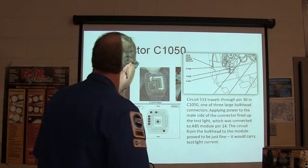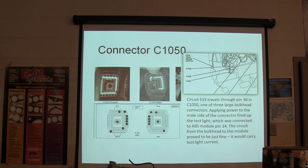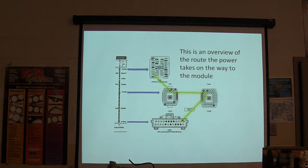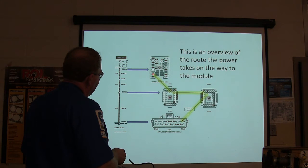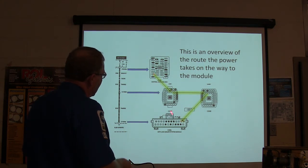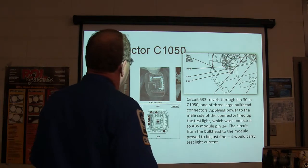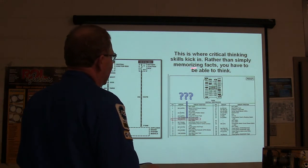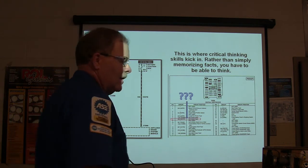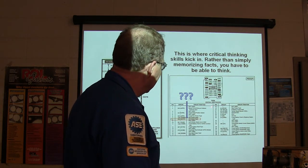The junction box sometimes has to be replaced. It's laminated with plates inside - you can't take it apart and fix it. Sometimes a windshield leak wets them and causes all kinds of electrical gremlins: headlights that won't turn off, speedometers going to 25 then dropping to zero. After replacing the box on one vehicle, the alternator went bad and confused the owner into thinking he had another bad junction box. But it was a bad alternator and a bad power relay - he had barely any power going to the fuel injectors, and tapping the power relay fixed it.